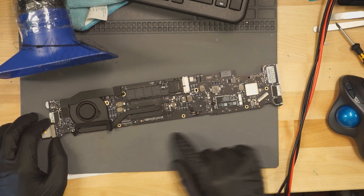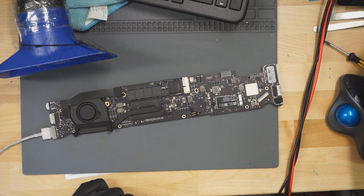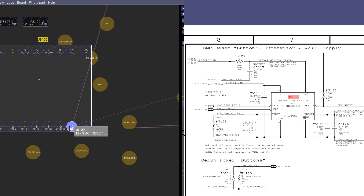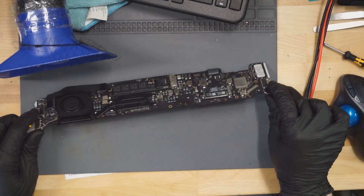As can be seen, we now have a fan spin. SMC reset actually goes to the JTAG connector. See here? SMC reset L — the signal that was held down — is on that JTAG connector. All I had to do was remove that JTAG connector, and now we have a working board.